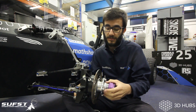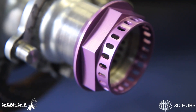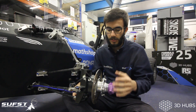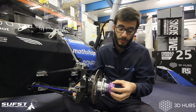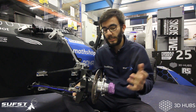The fit of these two bearings is absolutely critical with regards to both performance and reliability. The wheel nut keeps the wheel in place and is regulated by very strict rules in our competition. We decided to manufacture our own, as having a single wheel nut as opposed to the traditional four wheel nuts allows us to change wheels much quicker at competition, which may be necessary if conditions change when we want to move to wet tires.